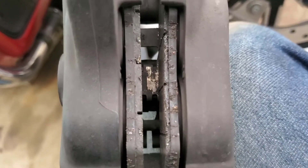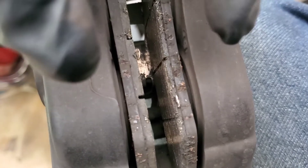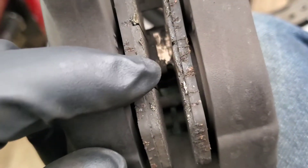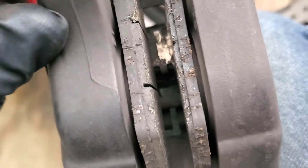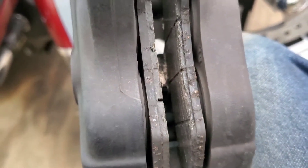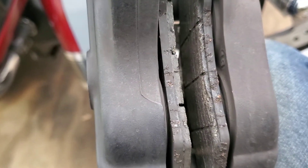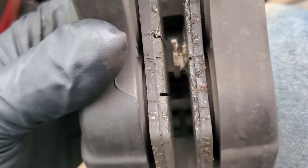You can see I've spread the pads out as far as they can go. Just use the flathead screwdriver and lightly pry between the pads back and forth. What this does is make room because as the pads wear, the pistons come in closer and closer, and the new pads — being thicker — are not going to fit into the caliper unless you spread the pistons back in place. There are clamp tools you can use, but really a screwdriver works fine with very light pressure. If there is a lot of resistance, double-check your fluid — maybe somebody added fluid when the pads were already really low, and now it's too full. When you spread the pads and push the pistons back, all that fluid gets pushed against the brake master cylinder cap with nowhere to go. As long as you're not doing a flush, you shouldn't have to touch the fluid when just replacing pads — only when replacing fluid.